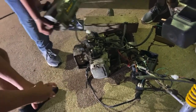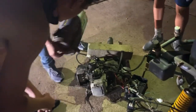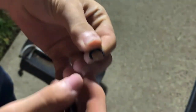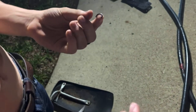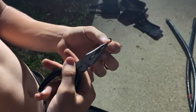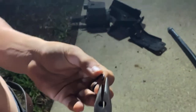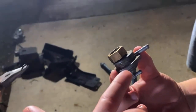Dang, why is it not getting fuel? We need top-tier fuel. There's just a shattered O-ring — it looks like it was cut almost in half. That might be part of the problem why fuel isn't getting to the engine. It turns over, but there's no fuel injection into the engine, and that might be part of the problem. This is just something that fell in there — there could be more stuff in there.